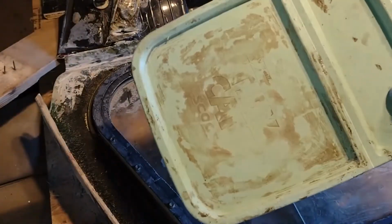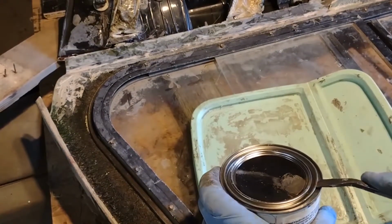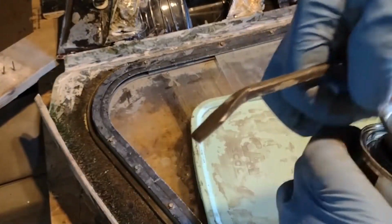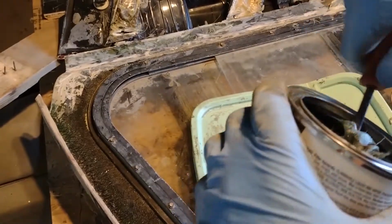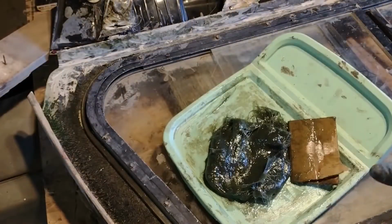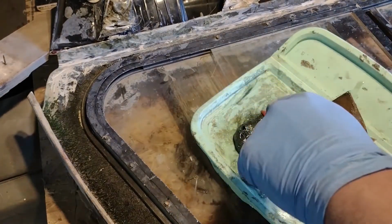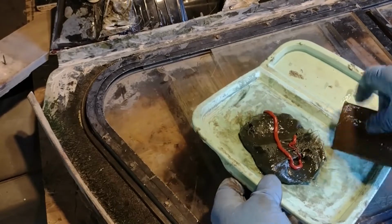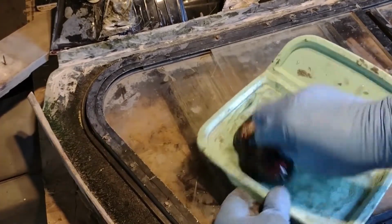Alright, well, we got our 5-gallon bucket cover. Got our material here. Our fiberglass hair. I like this because the fibers are mixed in there, so it's more structural. Get our hardener and we just do a stripe like that. And mix it till it's all one color. Don't want to be putting this on when it looks like a zebra.